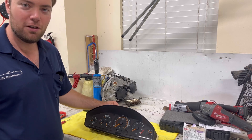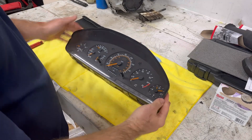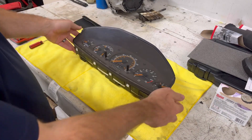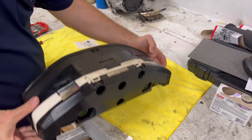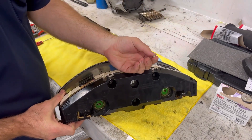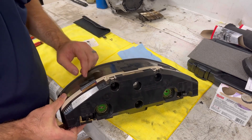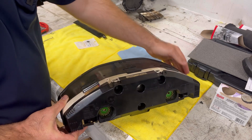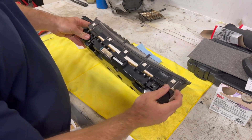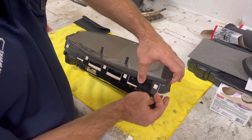So let's get started. We're going to start by removing the front bezel here and separating the two pieces. This is held in just two Phillips head screws — sometimes they're like a T10 or T15 Torx, depending on the model. Remove one there, one there, and then you just have a bunch of clips here on the bottom that you kind of have to simultaneously mess with.